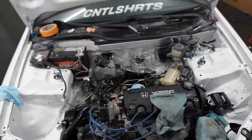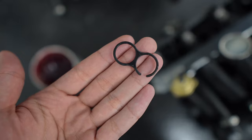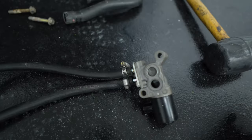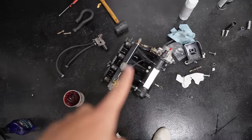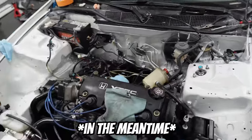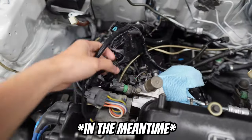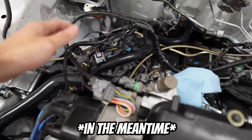The really only thing left is to clean up the harness in the back, and once the manifold's on everything should be pretty clean. The gasket broke on this IAC valve — without that gasket I literally can't put on the manifold, which means I can't get this thing started. I'm just going to clean up some of this wiring; it's a little messy and dirty from oil leaking onto it.